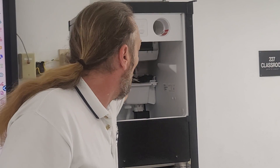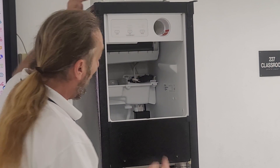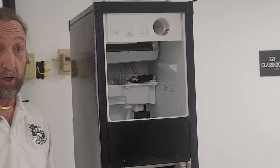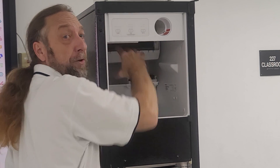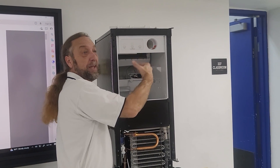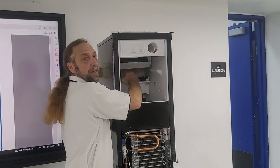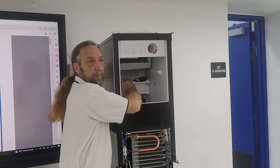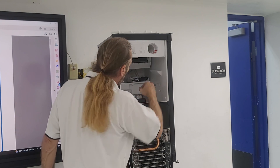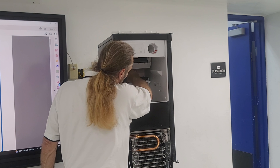This little gray hose comes down from the water valve and runs all the way up to the top of the unit. When the machine goes into ice ejection, the hot refrigerant coming from the compressor bypasses the condenser and is pumped directly to the evaporator, using its heat to release the ice slab. At the same time, the water valve is energized and re-supplies the reservoir with fresh water. So while ice is ejecting, the water valve is already refilling the container for the next cycle.